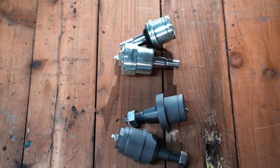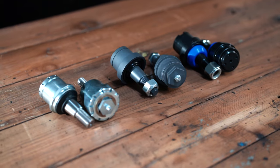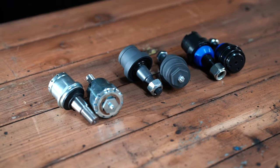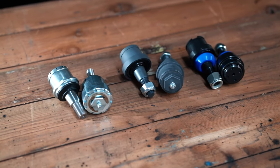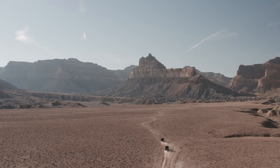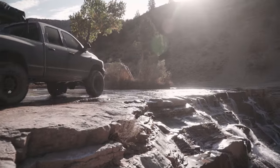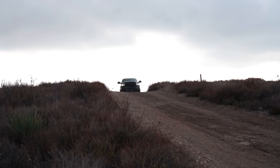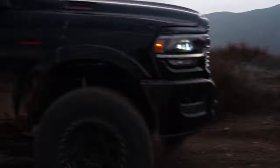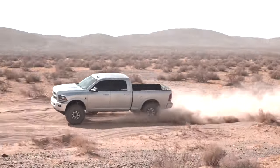A lot of people ask us about offset ball joints. To clarify: if you need an offset ball joint for caster, you need to change your control arms and check your cam bolts. If you need one for camber, most likely your axle may be bent. Most offset ball joints are very lackluster in performance and do not last long, especially given the weight of the front end of these trucks. I highly recommend against using any kind of offset ball joints, and you may also want to fact-check what your local alignment shop tells you.